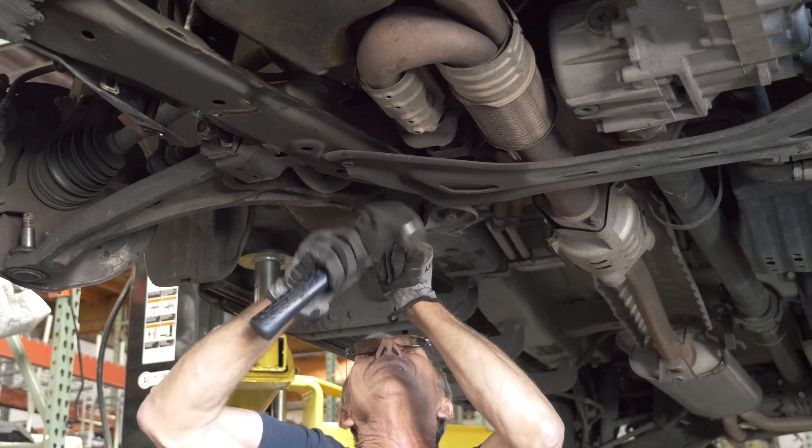With your car already on blocks, you can use a floor jack — put a floor jack under it and jack it up. We got it. It's got to be perfectly level to get that bolt in there and you've got to put pressure on it. Another way you could do it that wouldn't be as hard would be to not put the ball joint in the knuckle yet — jack the knuckle up, and then there's no pressure on it, which makes it easier to get level. There are a couple ways you can do it.